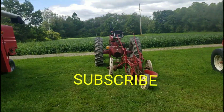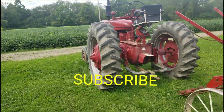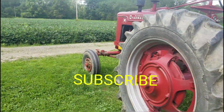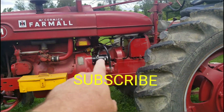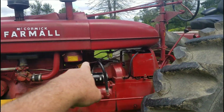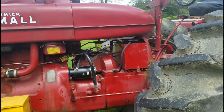Oh, I got the M running. I did a little bit more to it than I bargained for, but it all was needed. So I got the starter on there. I got a new fuel filter. I changed the oil, got the new cables in.